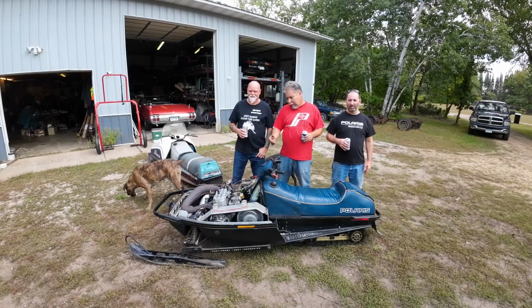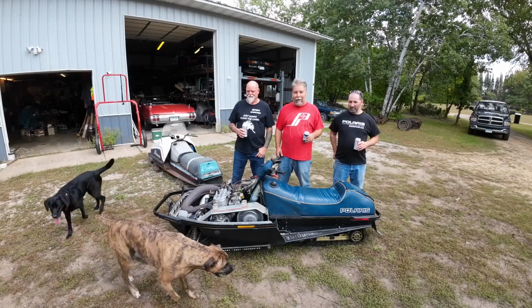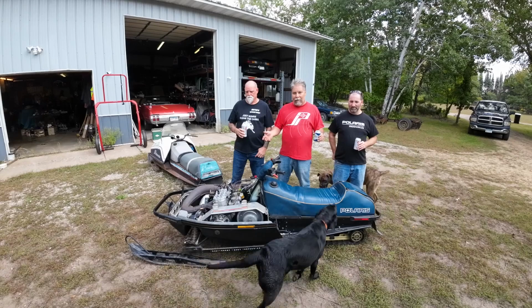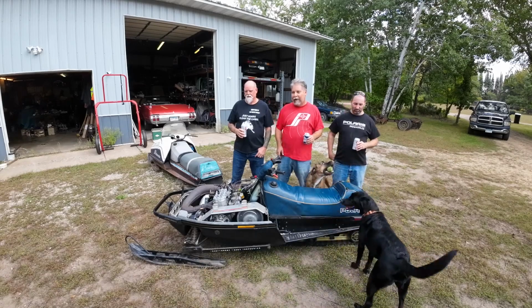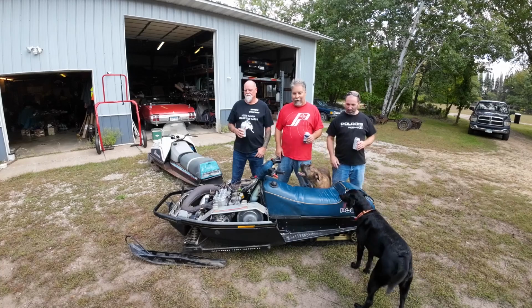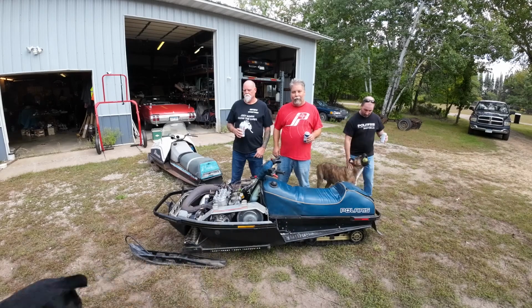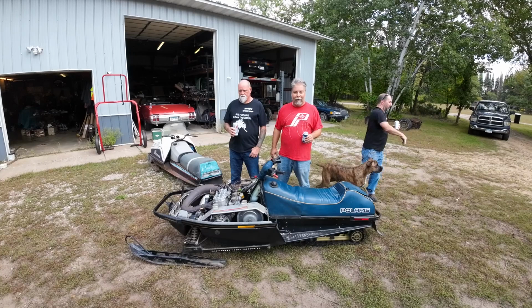Not bad. I ran it without the airbox because it was essentially 70 degrees. That's a good way to detune if you got to get your sled ready for warm weather real quick to do a couple test hits. Just take the airbox off. Anyways, that's the old trick with the old TXLs. If you got to run a TXL in warm weather, you drop the airbox off and they work great.